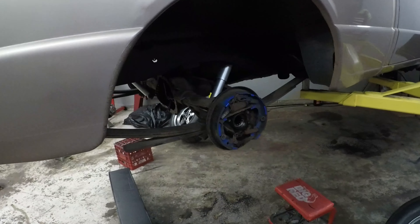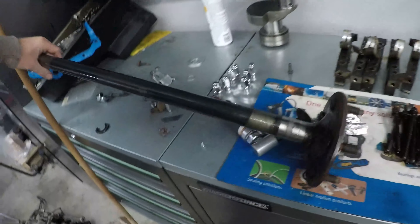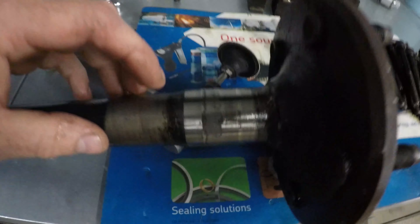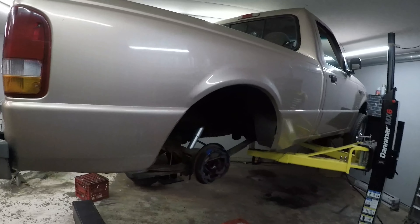Once I got it home and up in the air, I started pulling it apart — the passenger side rear wheel bearing, or axle bearing, has chewed the living crap out of the passenger axle. So I have to order a new one from Rock Auto. I really don't want to waste a bunch of money on this 7.5-inch rear end, but it is what it is. I'll get an axle ordered, get it put in, weld the diff up since I'm not planning on putting a rear end in it just yet, get a new axle seal and new axle bearing, and then we'll take this thing out for a drive and hopefully see how this thing rips.